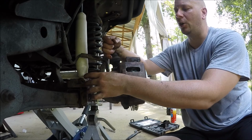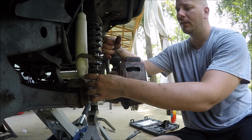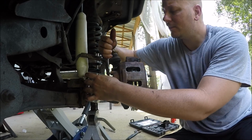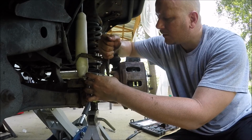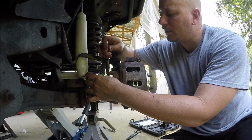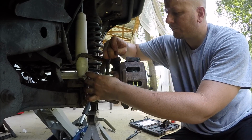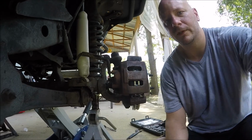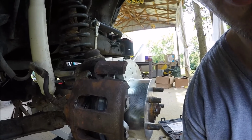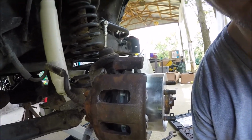All right, Marie, pump the brakes and hold them. Pump them 3 times and hold them to the floor. Tell me when you're ready. All right, do it one more time. There was no air come out of there. You would hear it go psh, or a little fart sound, and it didn't do that. It just came straight out. So we're moving to the other side.